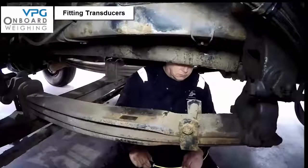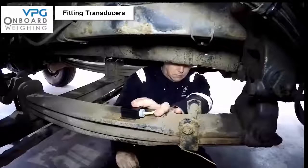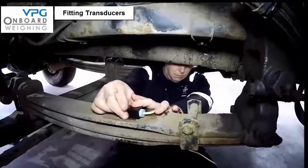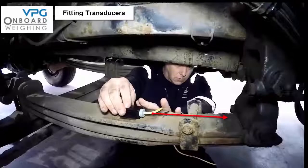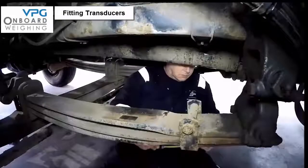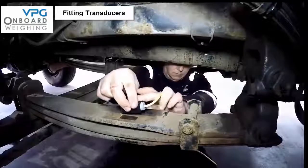This vehicle requires 2 steel axle transducers per axle. Firstly you will need to decide on the correct location for the transducers. The transducers must be mounted on as flat a surface as possible to ensure a strong bond of the adhesive. There are 3 very important rules for orientation: each transducer must be mounted with the groove around the transducer on top; each transducer must always be mounted in line with the chassis unless on struts; and the cable from the transducer must always point in the direction of the pivot point of the suspension component to which it is attached. Care should be taken to ensure the transducer cannot contact any part of the vehicle during the full range of spring movement. The transducers can be mounted at the front or rear of the springs, but the location will become important during system setup.